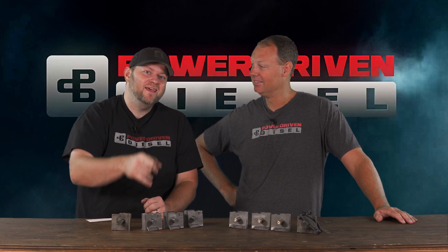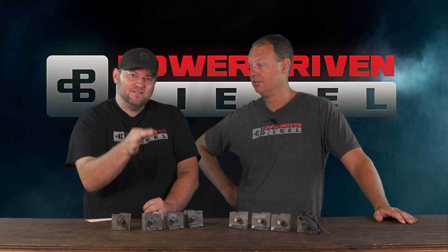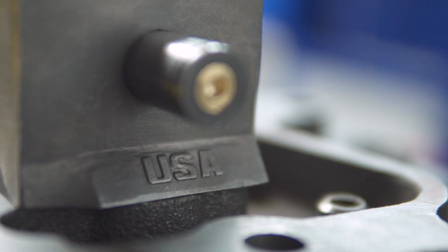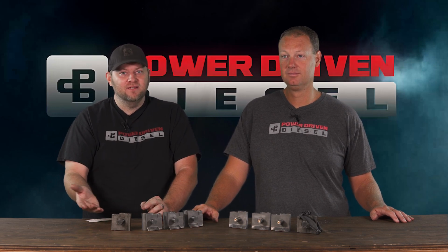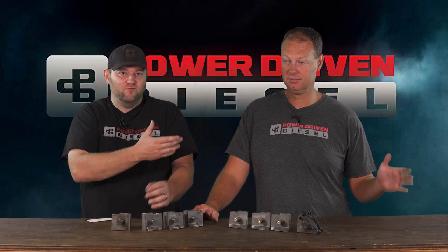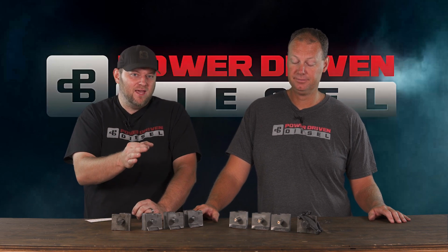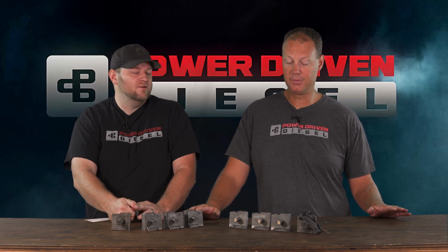And a final tidbit at the end here. If you have a warhead, we know there's some of you out there, the warhead has this cast soft plug on the bottom. Oil leaks out from under the rocker pedestal. These little bat wings will cover that up. No more oil leaks. So if you have a warhead and you're trying to figure out how to seal it up, there are some expensive options on the market. I don't want to call out companies because we've run some of their parts and they're great. This is an affordable way to stop that oil leak. Absolutely. If you have an aftermarket head that has a soft plug under the rocker pedestal and oil's leaking around it, this is perfect.